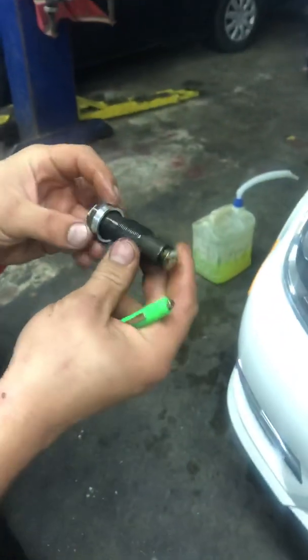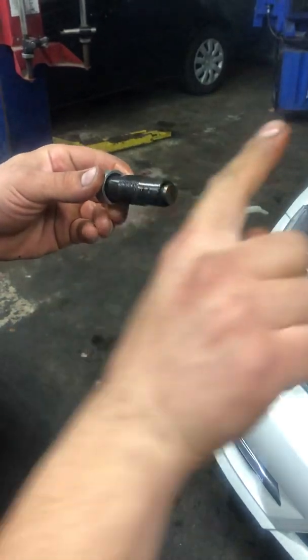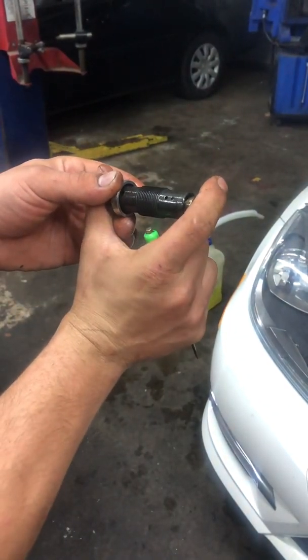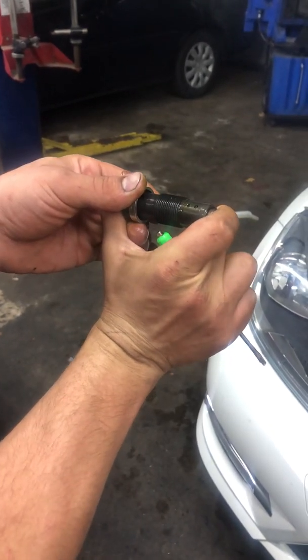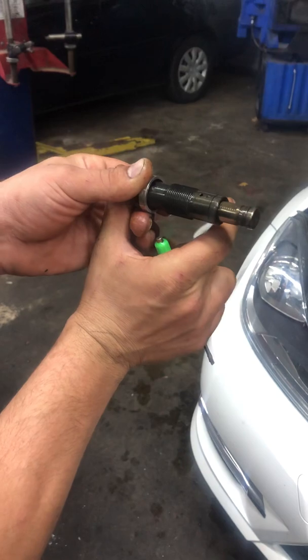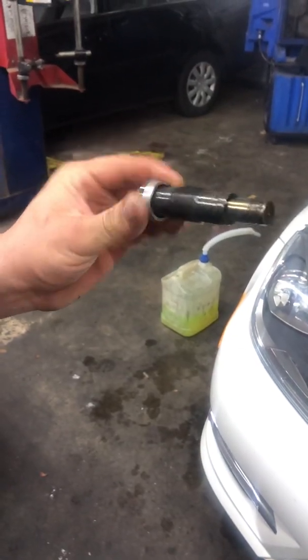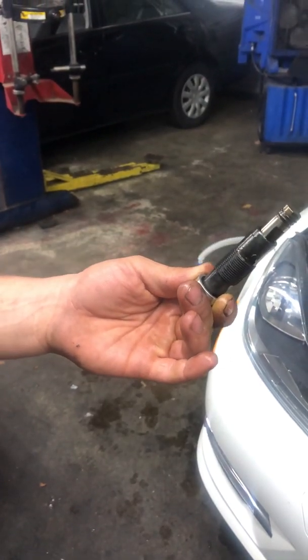So when you put it in, it screws into place. And then you take the timing chain, you rotate it counterclockwise, and it'll apply pressure on this side. It'll simply push the tensioner, the snap ring pops in the gap, and your tensioner pops out. Might save you some money from having to buy a new tensioner if you couldn't figure it out beforehand. We were only doing this for 3.5 hours to figure it out this time.